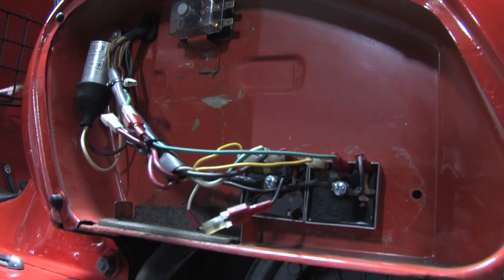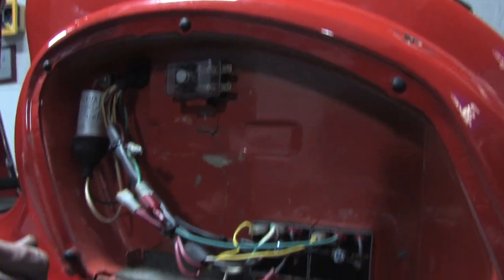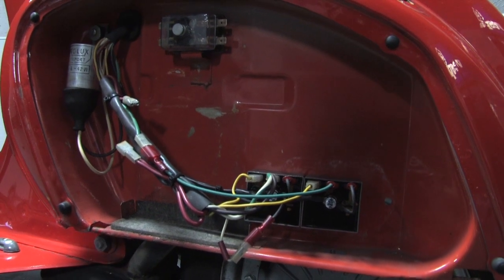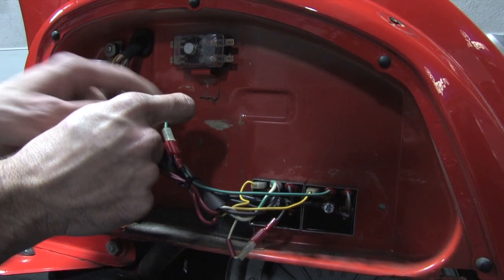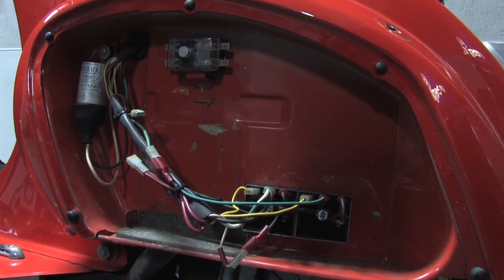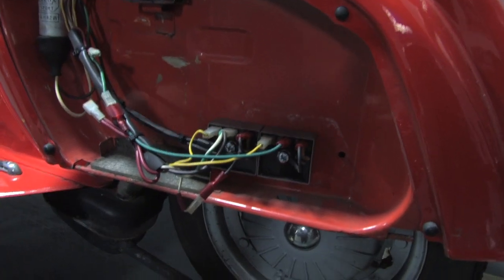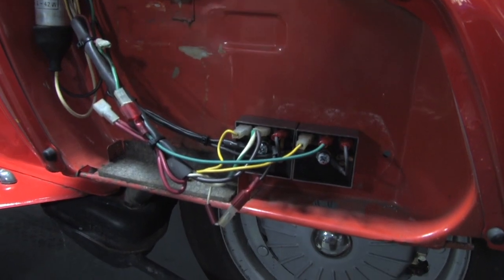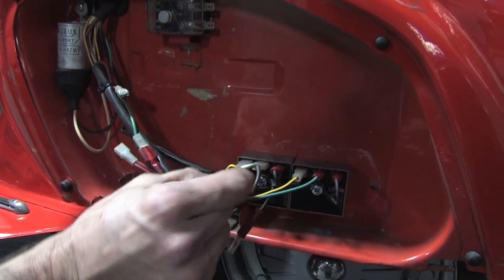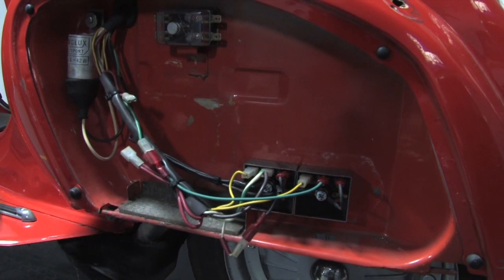The two yellow wires are from the actual coils — the center tap of those two coils is grounded, and the yellow wires are the power from the coils. You have one yellow going to the first regulator and the other yellow to the second regulator. On these scooters they have two circuits: one circuit powers the headlight with the green wire. Originally this terminal went to the fuse holder, so I extended it and tied it to the second regulator — that's the power for your headlight. The second circuit powers the taillight, brake light, horn, and turn signals. You can see the turn signal flasher still in here. Turn signals kind of work when you set up AC — they kind of never worked great to begin with — but if you do want turn signals, they will function on AC with this thermal flasher. The white wire with the green stripe and the brown wire that ties to your turn signal flasher are both tied to the second terminal of your first regulator.